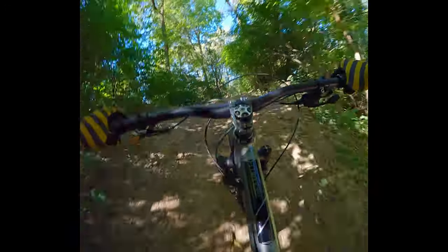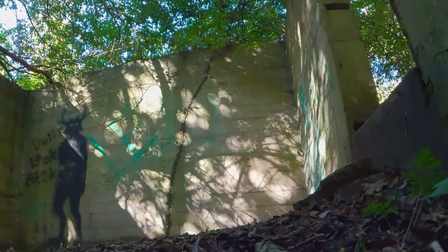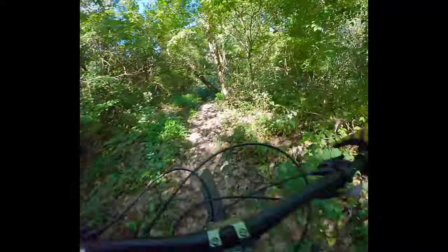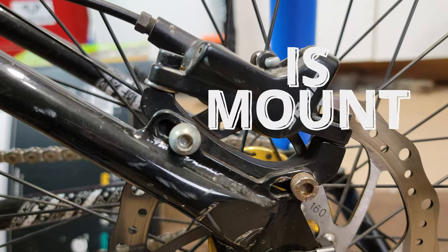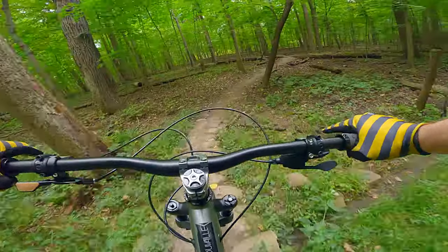There are a ton of higher-end used forks out there for cheap. As far as the frame itself, I've ridden more supple-feeling hardtails, but I am running a little higher pressure due to having inner tubes, and I'm hoping that running tubeless will soften the ride a bit — but that's part of phase 3. One issue that persists with my frame is the rear brake. I still wasn't able to completely eliminate the rub. From what I can tell, there's an incorrect tolerance on either the rear hub or the post mounts themselves. I was able to shim it slightly to get rid of the noise, but it came back after a couple of rides. In my opinion, post mounts are a bad idea on quick-release bikes — an IS mount is more helpful here because you can better adjust for imprecise tolerances. I'm a fraction of a millimeter away from perfect brakes. I'll get the brake issue resolved, then we'll put some more miles on this iteration of the bike.